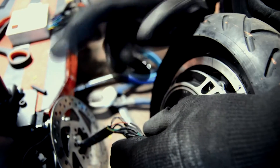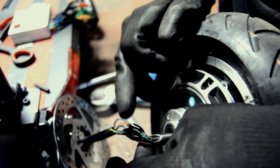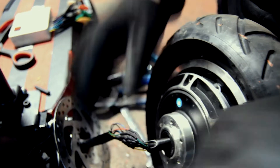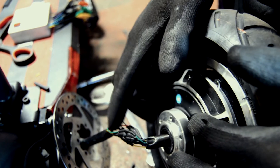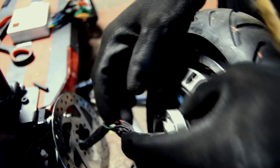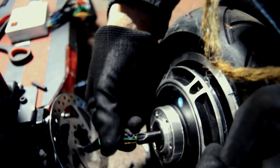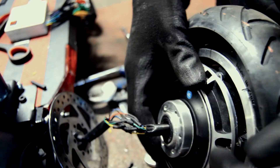There were two possible causes for the blue Hall sensor not lighting up: a broken wire — there was some tape around this section of the wire — or a failed Hall sensor. This actually had both: it had broken wires, but once we connected them the broken wires had shorted one of the Hall sensors. With all of that repaired, it's ready to go back together and get tested.